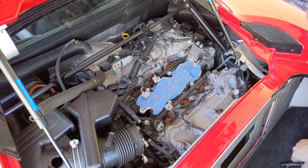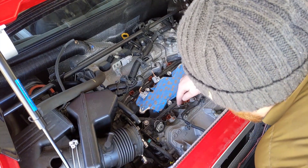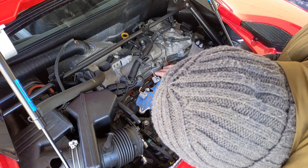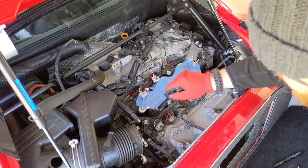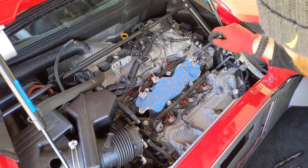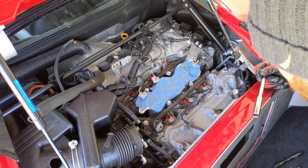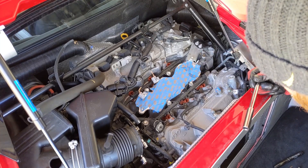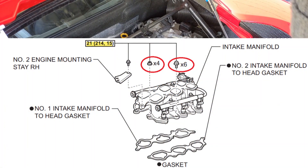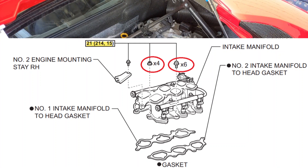I did not have to take that harness off. What I'm going to try is to take off this intake manifold as a whole piece, so these fuel rails will come with the intake manifold. We have 12 millimeter sockets here, here, here, and here — that's four. Probably gonna have to take off this one too, which is also a 12. I'm not gonna take off these fuel rails if I don't have to — the injectors will come right out with the intake manifold. The less we can touch, the better. And there are at least six Torx bolts, so let's work from the outside in.